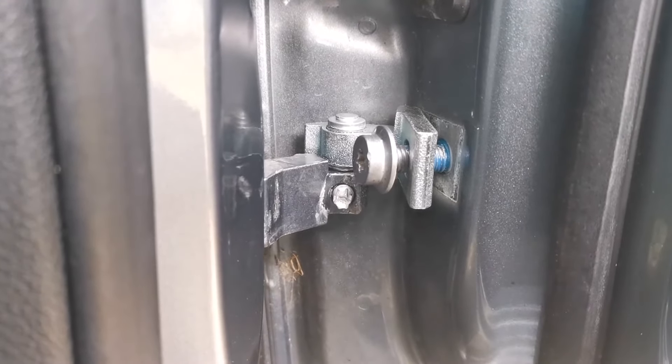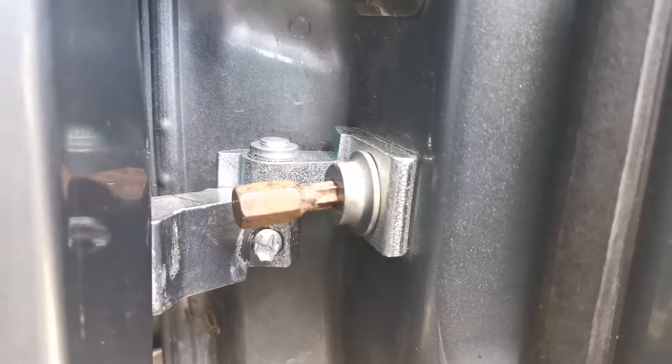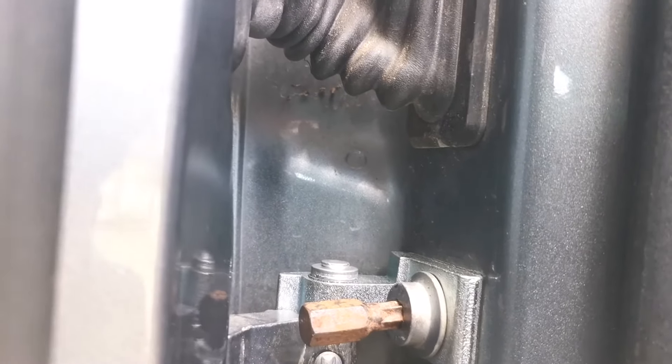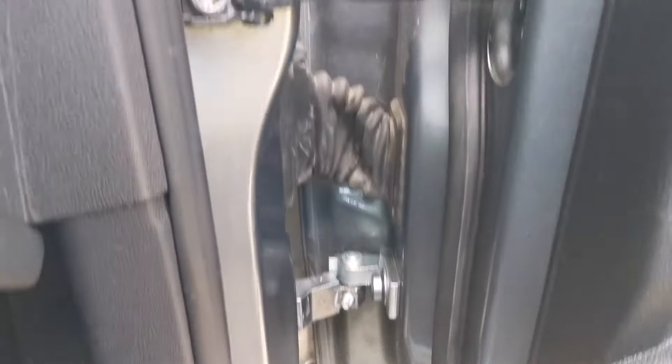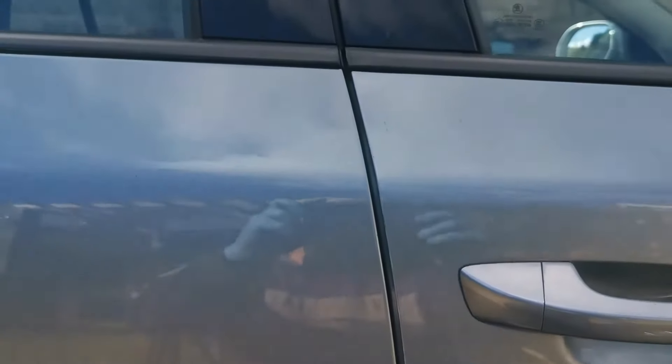Once you've got them both started, it's just a case of tightening it back up with your spanner and your bit. Once you've got it tight, you can pretty much line it up with the paint marks already on the door — this gives you an indication of where it should sit. It should be exactly the same because the parts are all the same; it's the same part number top and bottom. A little bit of adjustment back and forth just to get it in line, and now there's no play in the hinges at all and the door aligns almost perfect.